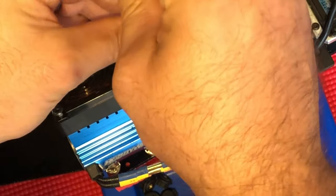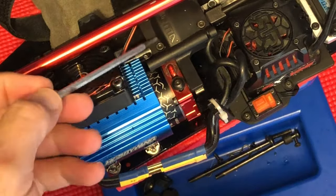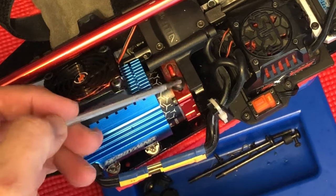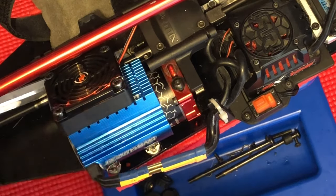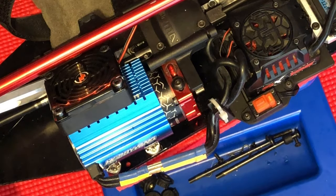I'm going to go ahead and put this notch in it, so I'm going to tighten it down — not tight, just snug — I don't want it wiggling around while I do this. It might be a good idea to remove the top cover plate off of your differential housing, but I'm going to be really careful and dremel this notch in without damaging anything. That's why I moved it to the outside spot. Here I go.